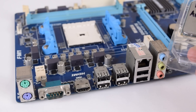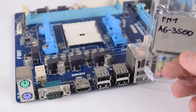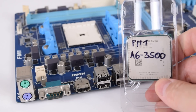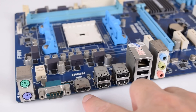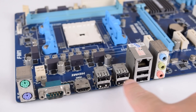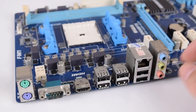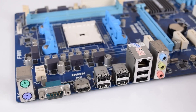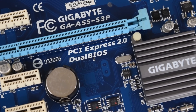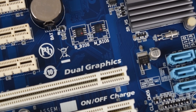When I received the motherboard from China I tested it on the same day and noticed some issues straight away. I started testing with the A6 3500 and simply couldn't get a picture out of the HDMI interface. I also had issues with some of the USB ports not working, so I used a dedicated video card and got a picture just fine. For USB I connected them to one of the headers on the motherboard. Motherboards with similar flaky issues usually aren't a good sign because over time more little issues tend to develop.